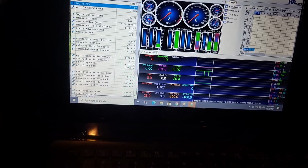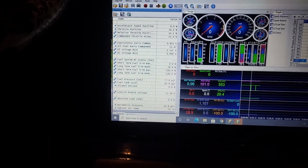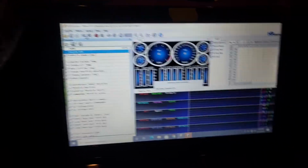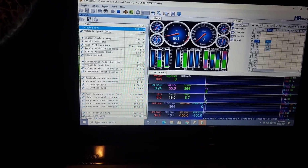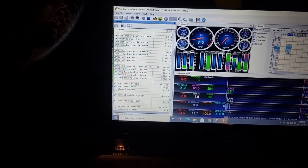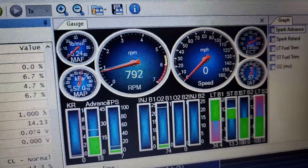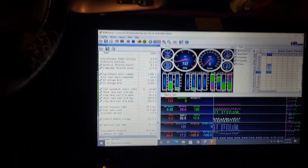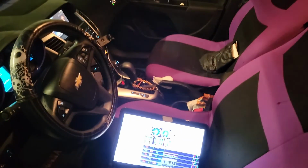And also, if you look at the data logger here, the fuel trims, basically long term, short term, are just totally pegged out. I have to reconnect now that we keyed on, starting the vehicle. So you'll see here long-term fuel trim's 35%, short-term is dropping now, depending on when it leaks or not. But you can see the idle is also erratic. It's kind of hunting around. And the fuel trim's 34% long-term, 14% short-term. Now it's going up, 19, 17. So more than likely it's vacuum leak related.